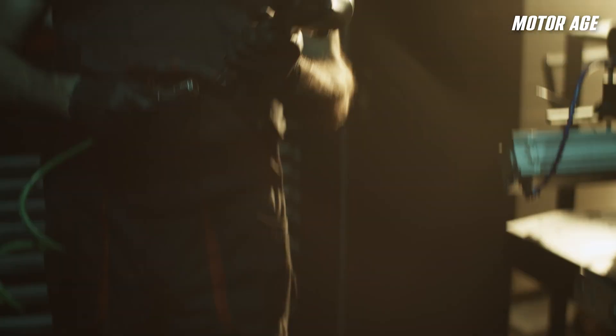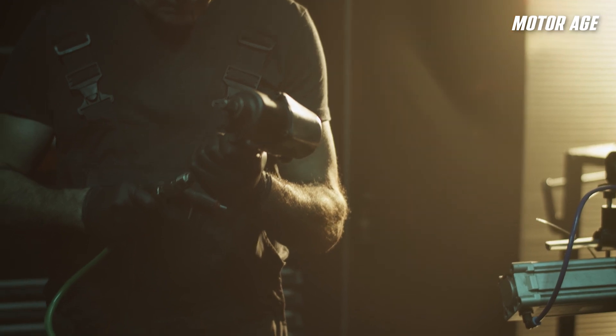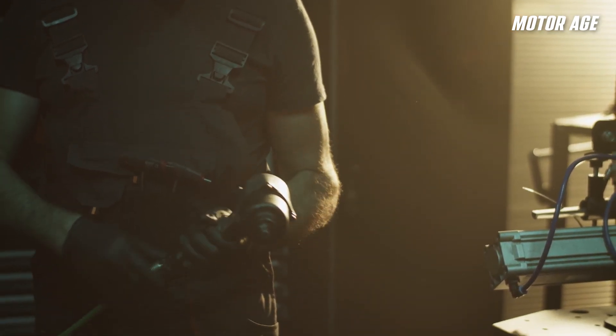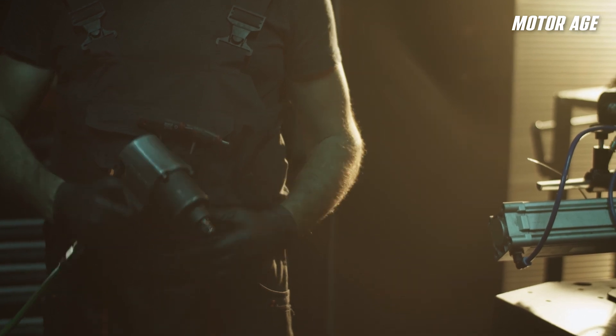I know what you're thinking — you know your gun, or you know when something's just right. But the problem is, axle nut torque varies greatly. Most applications fall anywhere between 140 to 200 pound-feet. And most modern electric or pneumatic impact guns can easily hit north of 1,000 pound-feet of fastening torque. It doesn't take much to quickly exceed the design bearing preload.